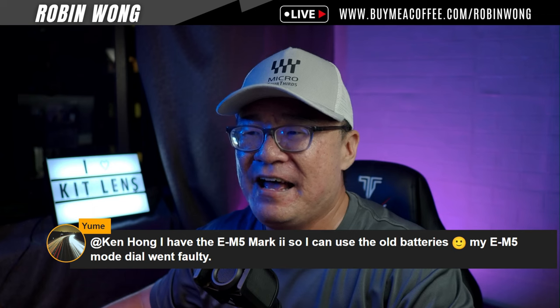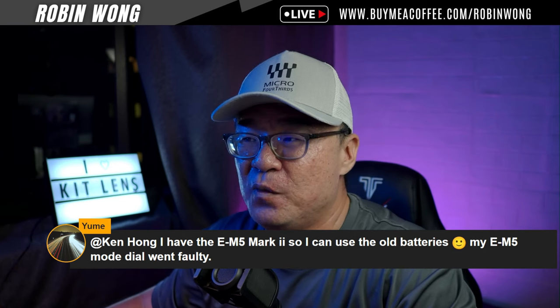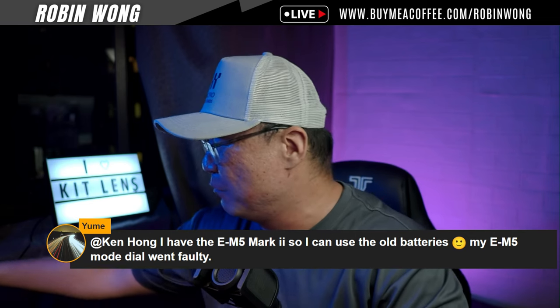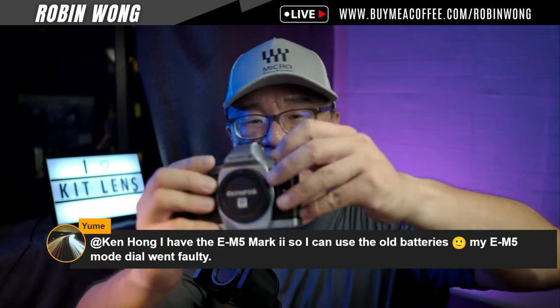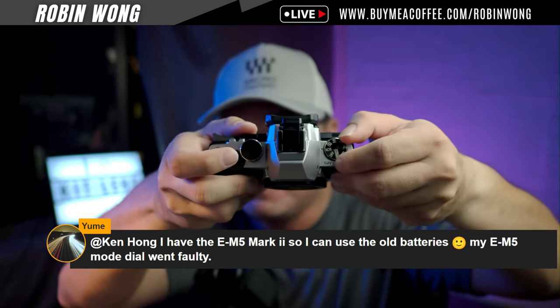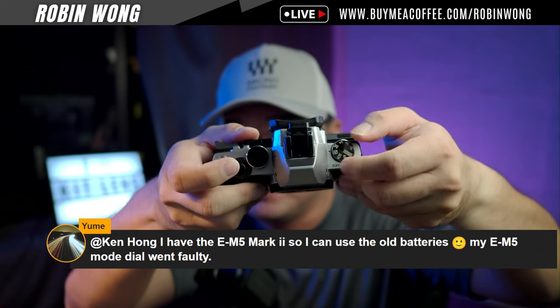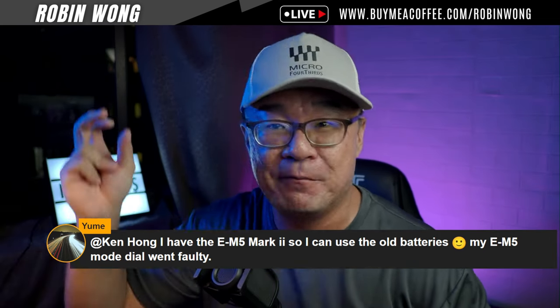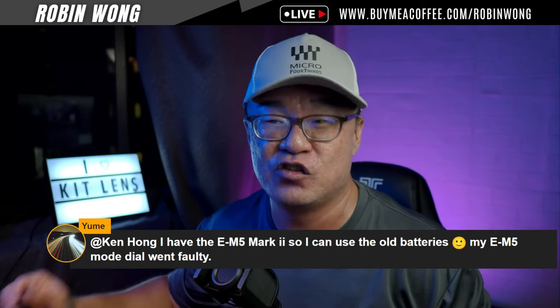Yumi is talking to Ken. I have the EM5 Mark II, so I used the old batteries. My EM5 mode dial went faulty. Oh, I think the mode dial went faulty because of the electronic contacts. It attracts dust. Somehow there's like dust and grime trapped in the electronic contacts, so that's why it went faulty. So if you can get someone to just open it up and clean the electronic contacts, then that should solve the problem.